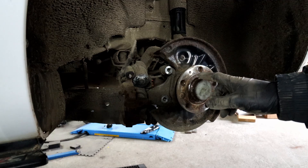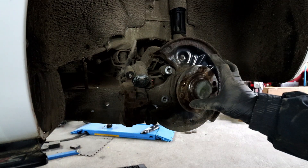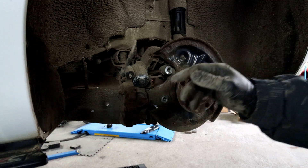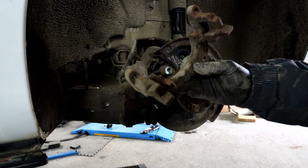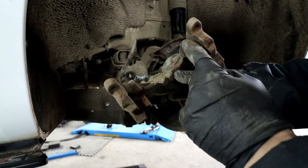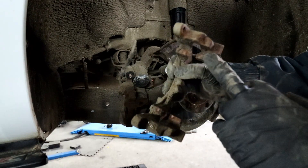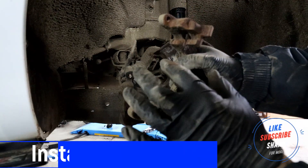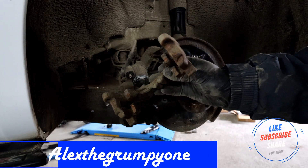At this point I use a wire brush to clean around the hub to make sure it's nice and even for the new disc so it sits on there spot on. I put a bit of copper grease around here as well before I install it all. On the carrier you've got the gaps where the pads sit, and as you can see they get corrosion and dirt there. So just use a file or wire brush to clean it all up to make sure when you put the new pads in you can slide them in and out freely, because they need to be free to avoid any uneven wear.